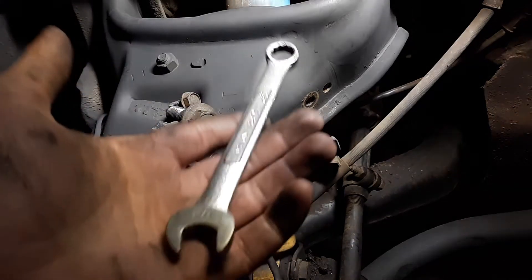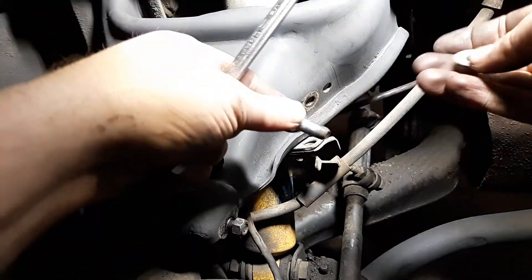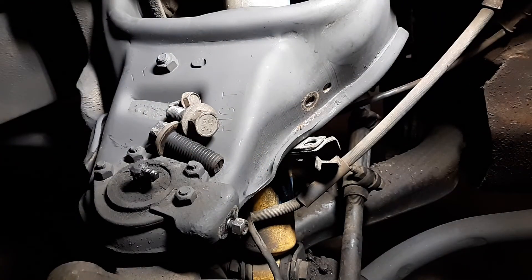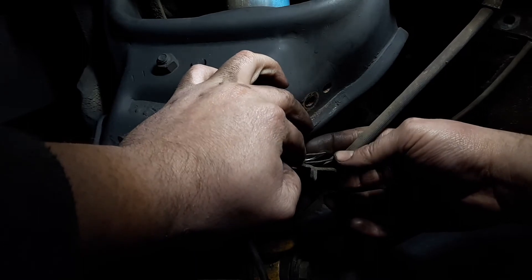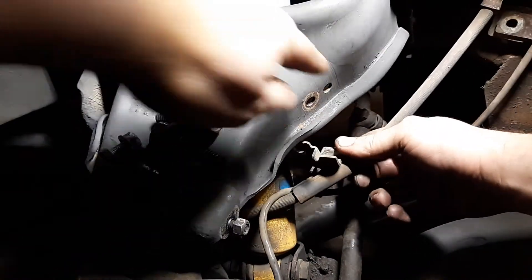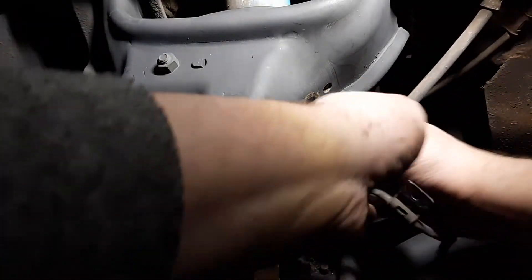I had to get my 13-millimeter and go on the inside of the upper control arm, hold the nut with one wrench while turning the ratchet on the other side to knock it loose and get the thing out. Make sure you remember which order everything came out so it goes back in the same way. The ABS wire goes on top of the brake hose, and they both feed into the back — the little knobs stick into the hole and they both line up together.